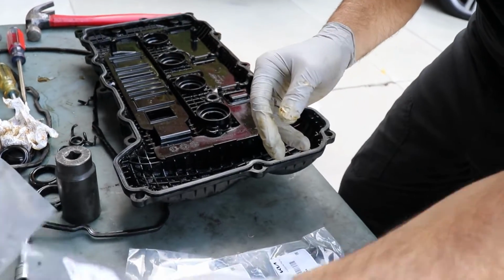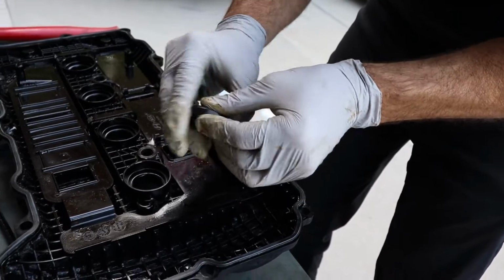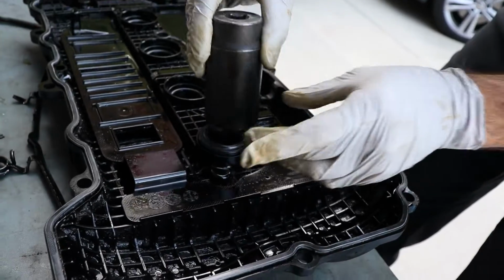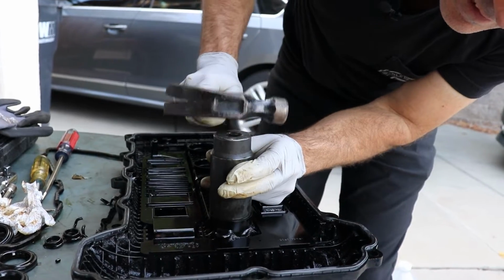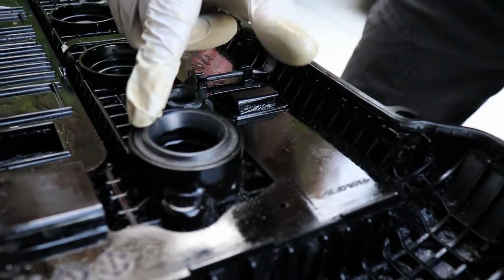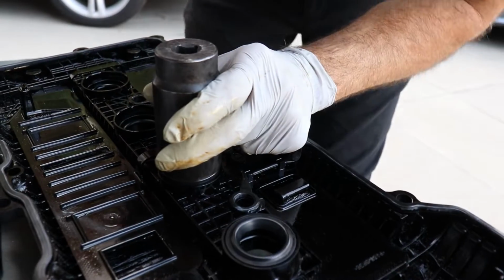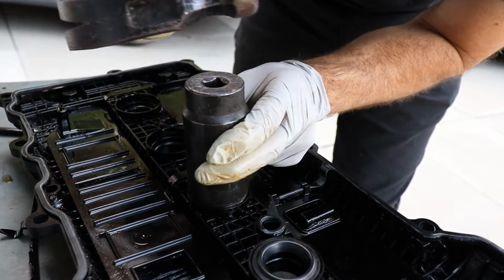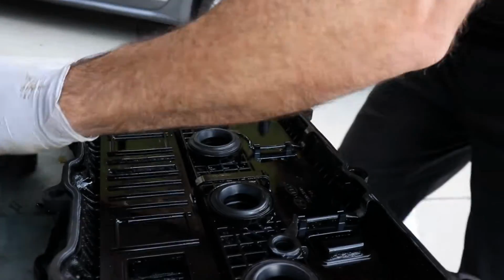All right. And now we're ready for our little spark plug seals. So for these, your hands are already kind of oily from touching everything. What I like to do is just get it started. You can take a 34mm socket and then just give it a light tap. Light tap into position. You just want to make sure that edge is flush with the plastic and you're good. Okay, go ahead and drop it in. Like I said, just get it straight. Get your socket. Just make sure it's flush. Do that the same on all four.